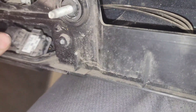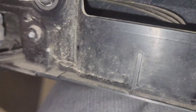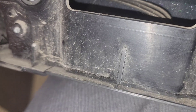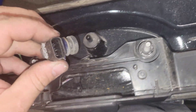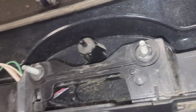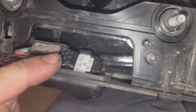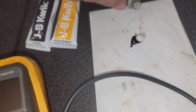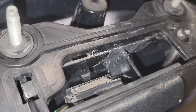When you put the new camera back in, set everything back in place, then grab some JB Weld or crazy glue and glue the tab back in there. You can put JB Weld on top of the crazy glue, or just use straight JB Weld like in this picture. I've got the old one out, I'm popping the new one in, and once it's in you'll see the material I use to secure everything — it's going to be a nice, clean, very secure job. Now we mix up a little JB Weld putty — this is the best and fastest way to do it.